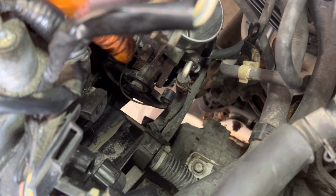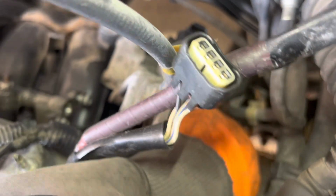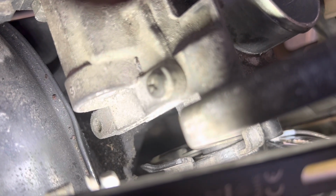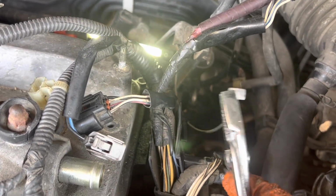Okay, let me show you this throttle cable down here. Can you see that right here? So that's obviously wrapped around this cam. So I just pulled it off, and you're able to bring it around and see how that work it out of its slot. It looks like it's gonna come out front ways. So I'm gonna just work it out. Well, just gotta keep rocking it out, and then I got a set of pliers here to try to get it off. Rest of the way. Bingo. Yep. That's what you're looking at for that guy. Alrighty.